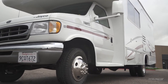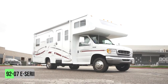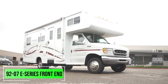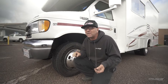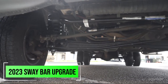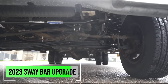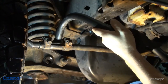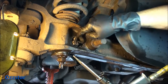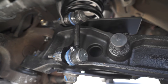This has the old school headlights, so that means this is going to be pre-2008 — so 1992 to 2007. Now what isn't old style anymore is the sway bar. We've upgraded it to run a 2023 sway bar on the front, so you're not going to have those annoying pins that tear up bushings going into your I-beams. Now they're going to be on the links like you'd find on a 2023 model.